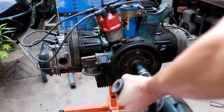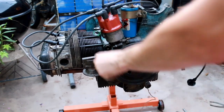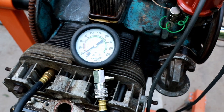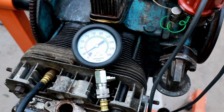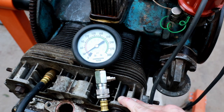I was really hoping I'd be able to get that side to fire off, but it looks like it's going to need a little more to turn this thing. So we're talking about on the order of 30 PSI of compression, which is nothing - not where we want to be in terms of compression performance. If I could get this thing spinning a little faster, I'd definitely expect it to go higher, but that's still pretty bad.